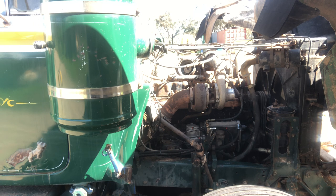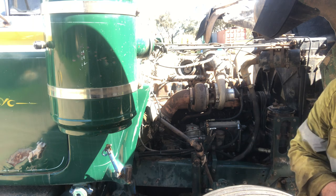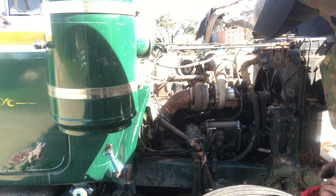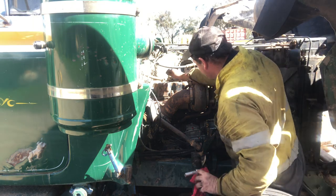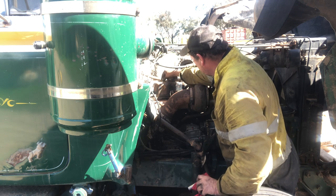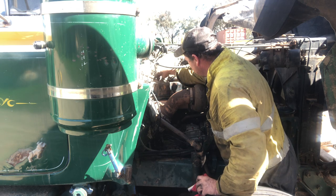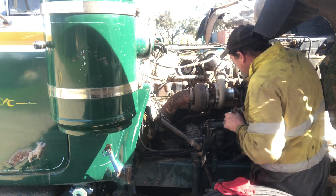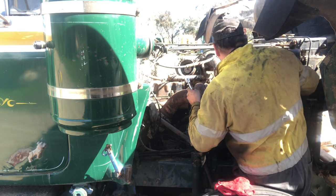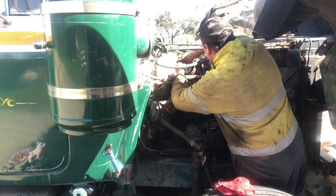I've got all the gaskets there for the rocker covers and the breather crossover and everything, but I just don't have the right glue. I always like to use a Loctite 406 on it. It just seems to do the job well. So just so it doesn't piss oil everywhere, I'll just bolt it back down. The front one hasn't moved, obviously, but